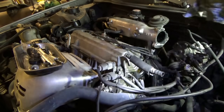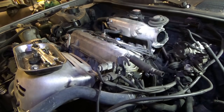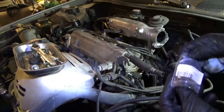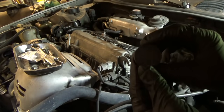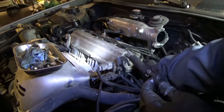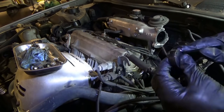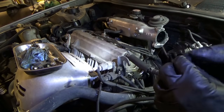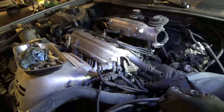So the new plug — made in Japan, cam plug. That's the original brand: NOK. We can get a little motor oil from inside the engine or somewhere where it's been leaking, just lubricate the outside of it, and then gently tap it in. It almost wants to go in on its own.